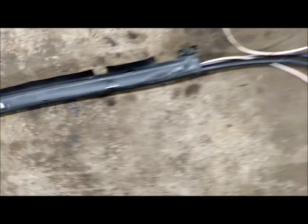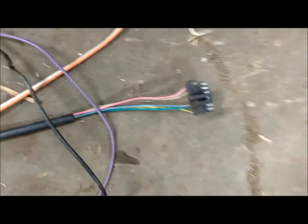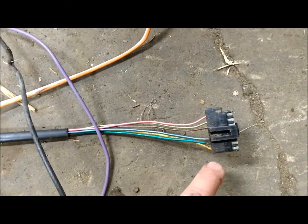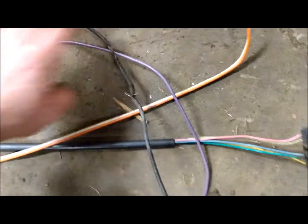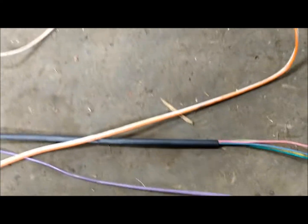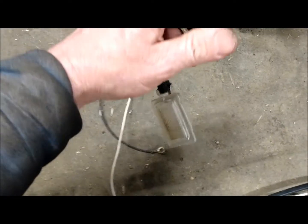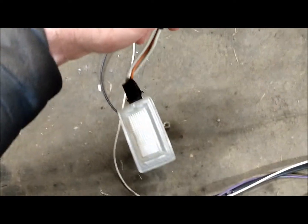It comes out to the same plug as all the other years, except the other one has that extra wire for the third brake light, and the purple is always your rear defrost. It is soldered onto a softer, more flexible black wire coming out the back. This orange wire with the white is your optional light switch that goes to the secondary dome light in the back of the car. There's an opening already in all the cars through all the years — a little rectangular spot for this light — so you can add that to any of them.